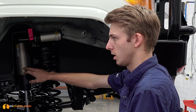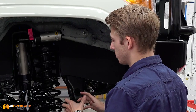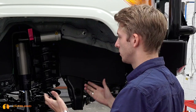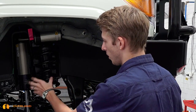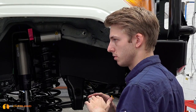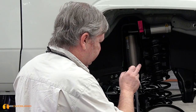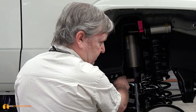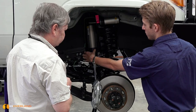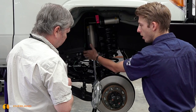The BP-51 is a 51mm bypass shock with fully adjustable compression and rebound. What that's allowed us to do is put on a nice heavy coil to carry the extra weight of the vehicle front and rear, and then set up the shock so that the customer's ride and control is top quality. Now I can adjust that ride quality myself with those two adjustments. Yes, you can — we supply a C-spanner with the shocks, which hooks onto each of these notches, and you can adjust these rings one way or another.